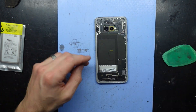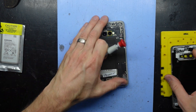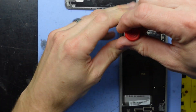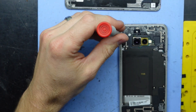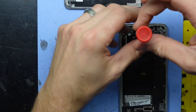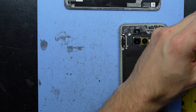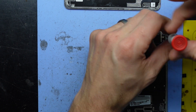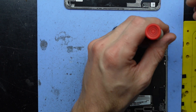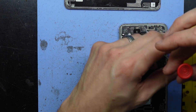One back cover. Now I should be able to take off this top half of the cover and that will get me to the battery. I'll keep this on heat — if I keep that on heat it will then stick back with a little bit of adhesive. Most of these screws don't really want to leave. But being this phone is about five to six years old, this will be one extremely tired battery. Samsung usually print the build date on their batteries, so I should be able to see that on there hopefully.